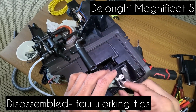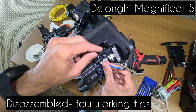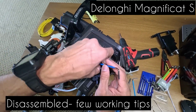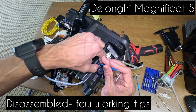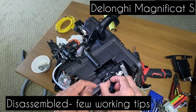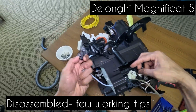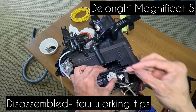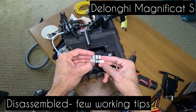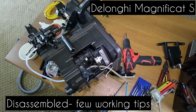You pull off these electrical connections, these lugs right here. These small Allen screws are what we need to take off. This is because we are inspecting the whole generator. I wanted to see what the issue was, because I still had water leaking even after checking all the connections. So I believe there's something wrong in this valve head right here. Rotate and pull off slowly. This one will need a little bit of wedging because of the O-rings. Okay, and this head right here, this was broken.